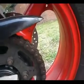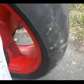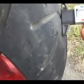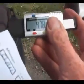Chain and sprockets — you can see they're not hooked. At this sort of mileage they'll be genuine and they'll last an awful lot longer than 22,000 miles. The rear tyre is again a Bridgestone Battlax — put on as a matched pair — and I'm showing 4.7mm on that, so plenty of life left in that back tyre.